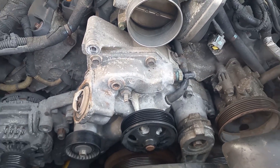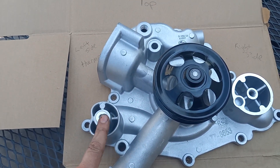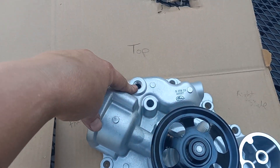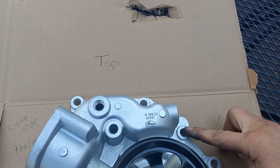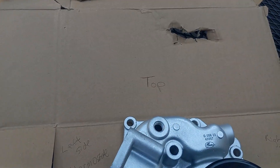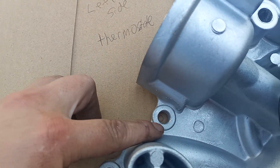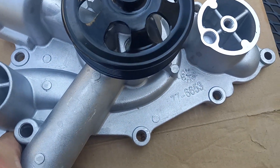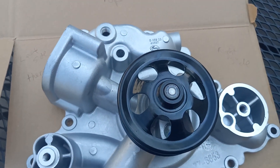I'll show you how I keep the bolts organized — just a little trick I do. Here's where the tensioner goes; it didn't come with the new one. It's the left tensioner, and this one's for the belt tensioner. Then the bleeding block-off bolt goes right there. All these empty holes are your other bolts you have to undo to get the water pump off. To keep them organized, because bolts are longer and shorter, I got a pin — put a mark in each one, then label top of the water pump and bottom. I just poke the bolt right through the cardboard to keep my bolts organized.